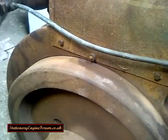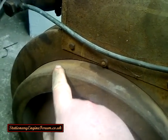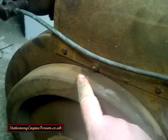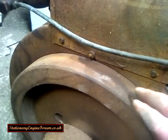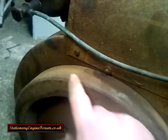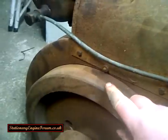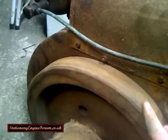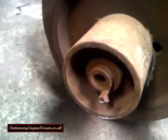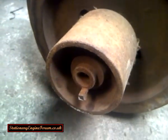What confuses people is when they are setting the timing up statically — as the engine is now — they get the click with the top dead centre mark a little way before top dead centre. This makes it difficult to start, it's likely to kick back at you, and when the engine does start running at decent speed the spark ends up way round, so there's no chance it's going to run. You want it sparking when turning by hand actually at top dead centre, which is when the keyway is exactly at the bottom.